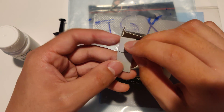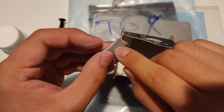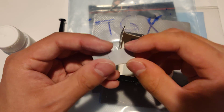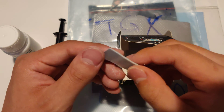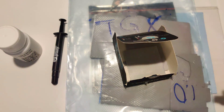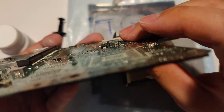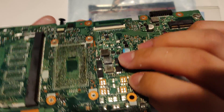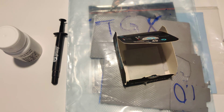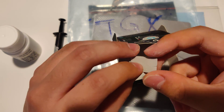So this has simply been sitting around for two years. And as you can see, my fingernail can't make much of a dent in it. And when you fold it, it cracks — it's gotten brittle and crumbly. And that's not very good if you're trying to cool down various components on the motherboard with different heights, because this lacks the compressibility to conform to that uneven surface.